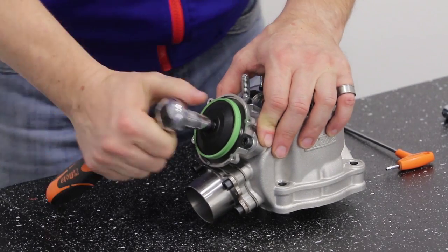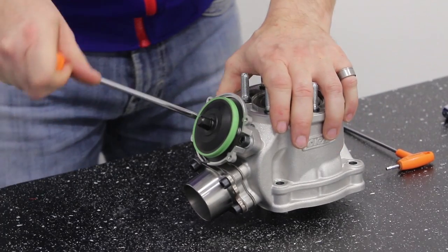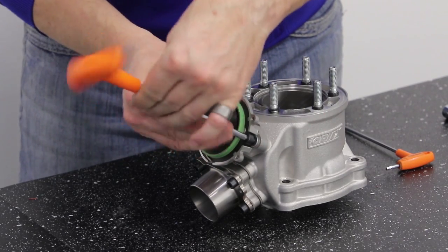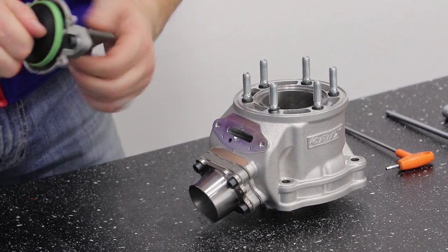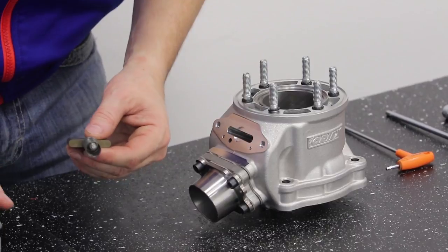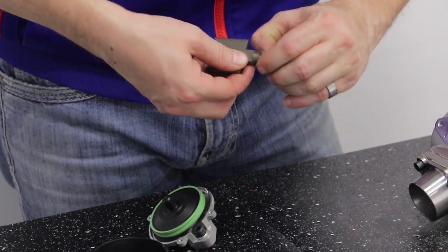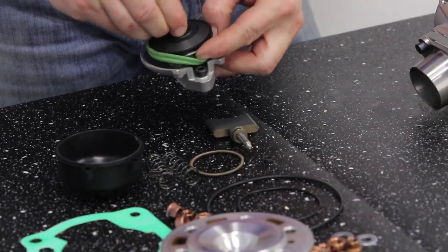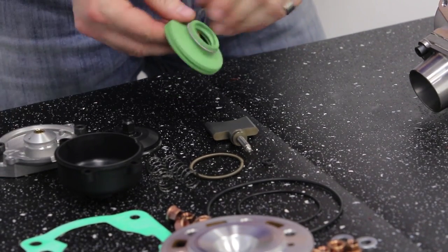Then, with a 10mm wrench, we unfasten the small piston and the two screws of the housing. At this point, we have already unfastened the guillotine, where inside the second of the push springs are located. Also, the contact O-ring, the bellow, and the final push spring.